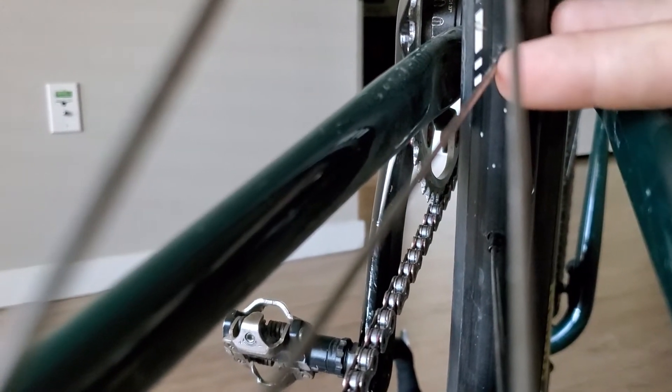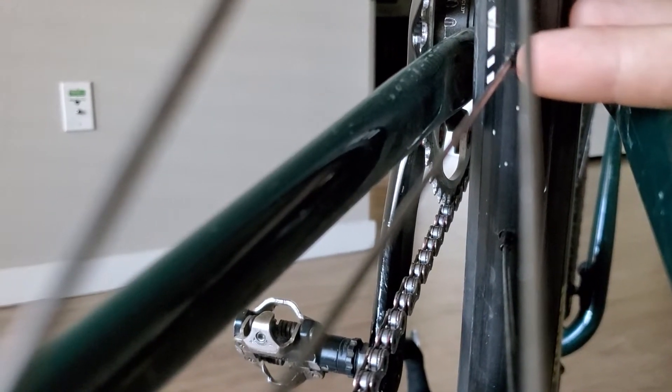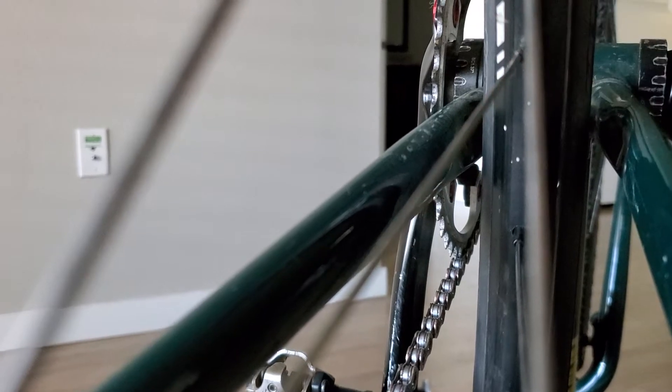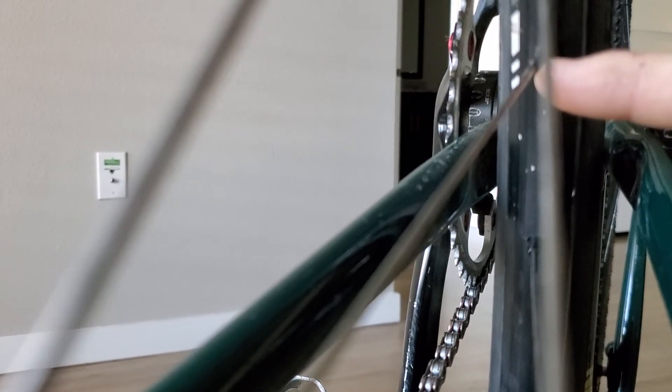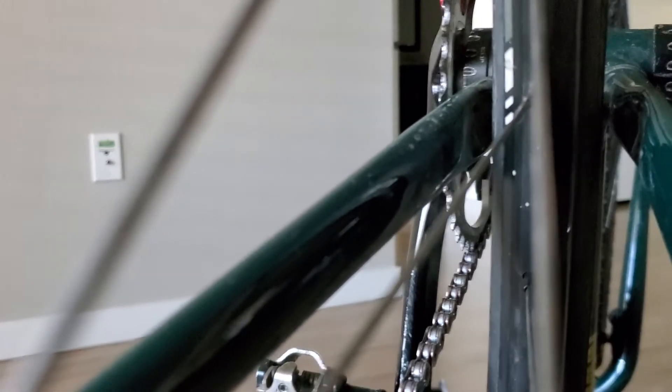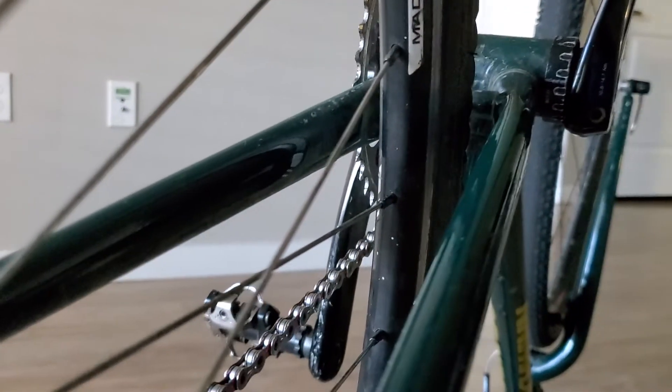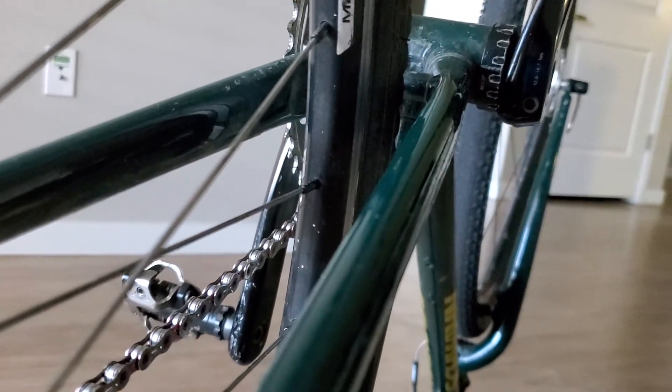So I want to figure out which way the nut screws onto this bolt, because this is simply a bolt screwing into a nut that has a T-head inside of a channel. We want to lefty-loosey the drive side on this bike, and righty-tighty the non-drive side to pull it towards the non-drive side — and thus get a better riding experience.